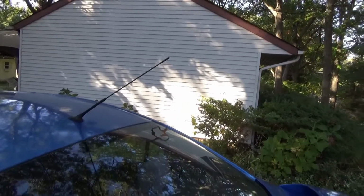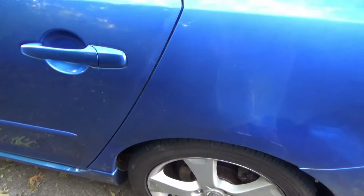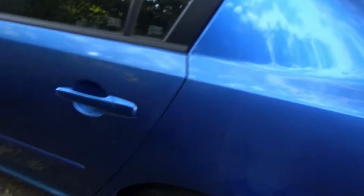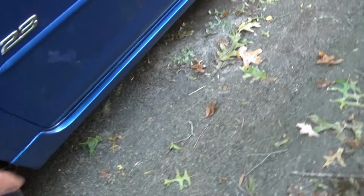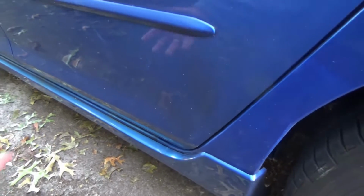The other thing was all chewed up and cracked. Okay, here's the other body work I did right here. Not perfect, but as I said, I used Bondo glass, spot putty, all those things. And here, of course, the side trim. There's two screws right in the front here. You undo these two screws, and then you sort of just bang the thing forward from the back here. Obviously, if you have rust here, it was easy to do, but it doesn't matter. Just bang it forward, and it will come off, or you just pull it off.